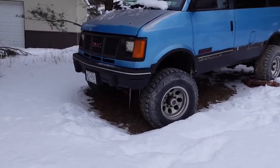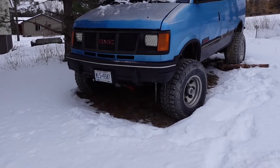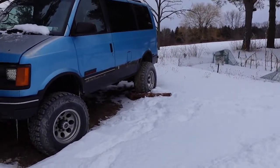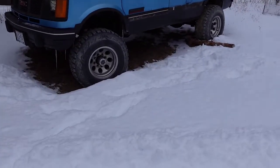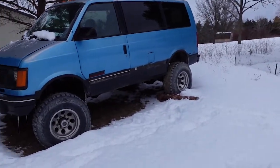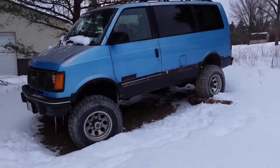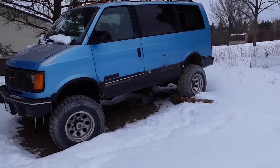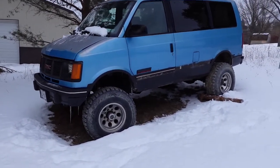There's a Dana 60 Kingpin from a 90s Ford F350. Got the matching Sterling 10 1/4 with the Detroit locker. The Warn premium hubs. Let's see, NV 4500 transmission with a 241 selectable transfer case. It's a 5-speed trans. 4.10 gears, and up until just recently, it had a 4.3 V6.